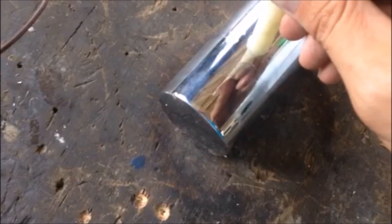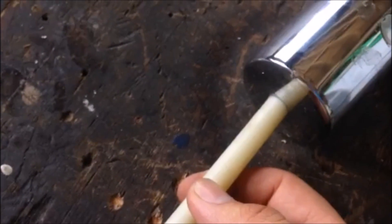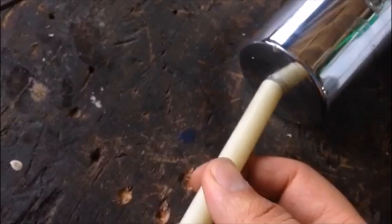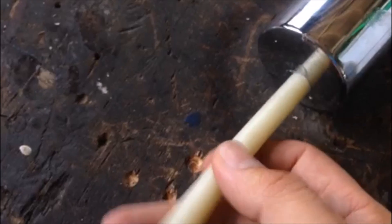When I went to lift up the coil, it burnt my hand. This is a hot glue stick right here. The coil is so hot right now it's actually melting this hot glue stick. So even though there's a negative and positive on the top of this coil, it's very imperative that you do not hook it to direct DC 12-volt power. You need to be able to pulse the negative. When you hook it to direct power, it's pretty much a dead short and it gets extremely hot. You can see it melting this glue stick.